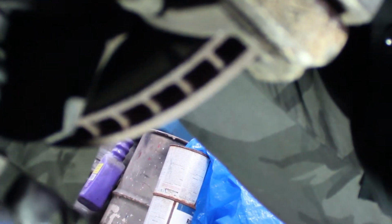Let it down a little bit. Okay, jack it up. Make sure when you're doing this, you don't grab hold of the backing plate, which would be this plate right here, and bend that, okay? Take it up. Just wiggle it around as you jack it up. You need somebody else with you to do this. Okay, stop. Now we can put the nut on there because we have enough of that ball joint thread protruding.